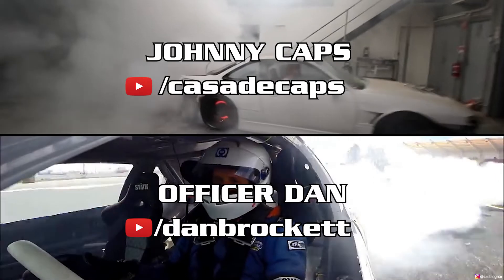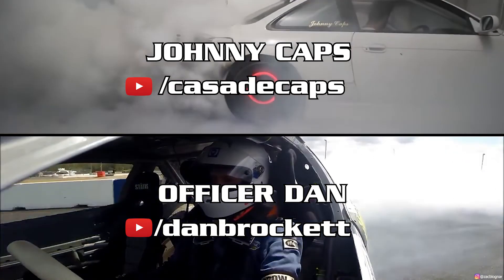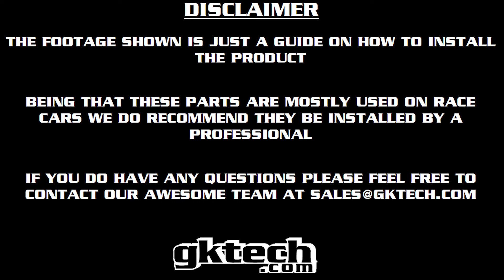And that's it. Make sure to torque these all down with the subframe fully up so you don't overstress the studs — you don't want to mess that up, I promise. If you can't install these, have a pro do it, or reach out to us with any questions at the email address shown on the screen. This has been Officer Dan, Johnny Capps, and Real Wheels Only, or We Can't Befriend Zach. Peacing out until next time, we have another how-to.